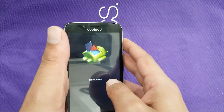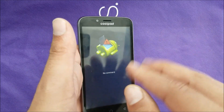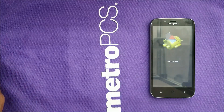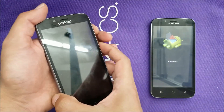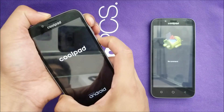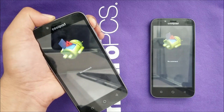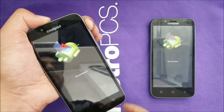I'm trying to hold my finger on Volume Up but it doesn't do anything — the phone is stuck on this screen. Someone might think this is just an issue with this particular unit, so I'm going to bring out another brand new phone from the box and perform the same thing. After releasing Power and keeping Volume Up held, it looks like nothing happened on that device either. So it seems like Coolpad has a known issue with the hard reset process.